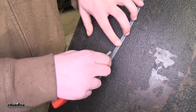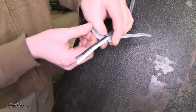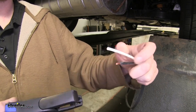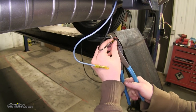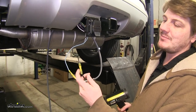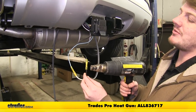We're going to peel back some wire so we can run it to the front, then trim off the excess. Now we're going to strip back some wire so we can connect it to our butt connectors. We'll connect the black wire to the black circuit and the white wire to the blue circuit. Then heat shrink your butt connectors — it's recommended to use a heat gun rather than an open flame so you don't burn the ends, which can cause them to deteriorate rapidly.